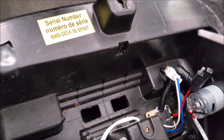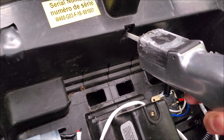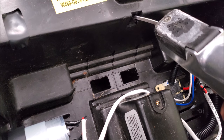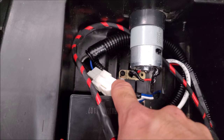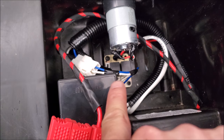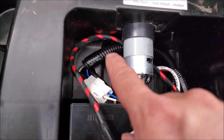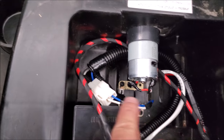Our newer 12-volt battery is a little bit taller, so to make the battery holder fit we have to cut it a little bit. I kept the factory connector in here because I wanted it to be different from our plug-in connector — just in case someone's trying to charge it and accidentally plugs it in, I don't want the motors to activate. This makes it dummy-proof.